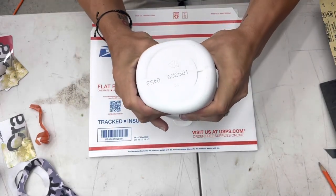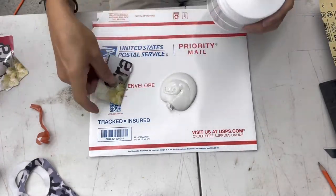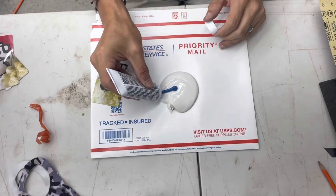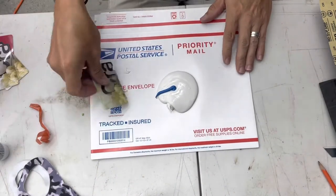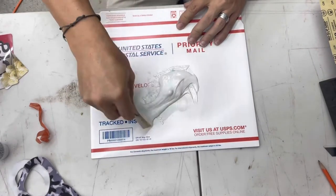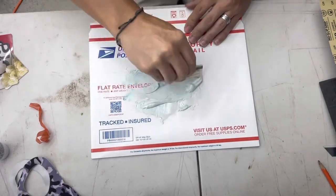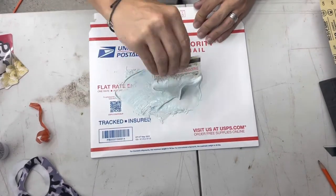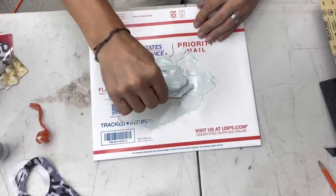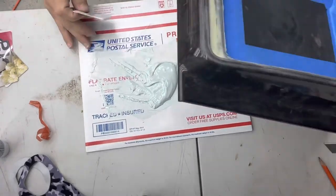So the consistency is about the same as the other filler, and the smell is the same sickly sweet. But what I noticed when I was mixing it up is that it does feel a little more sandy, a little more grit to it. And then the application itself was noticeably lighter. More of a joint compound that you would work with on drywall, right?